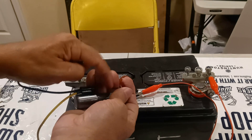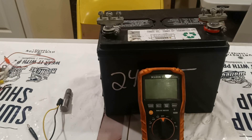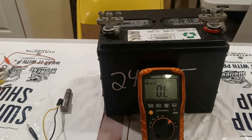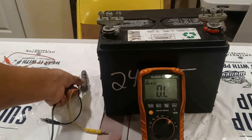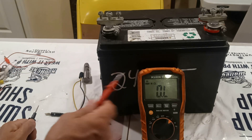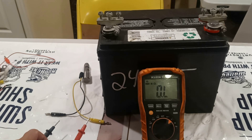Now the multimeter test — put it in ohms. The solenoid is kind of far away, but if I get between 5 and 5.6 ohms, this shift solenoid should be passing this test. Now, one thing before anything — Toyota doesn't mention this, but it happens in so many cases.